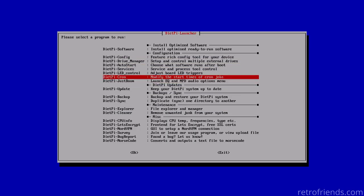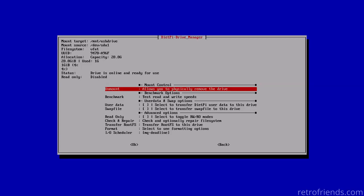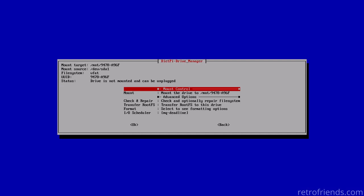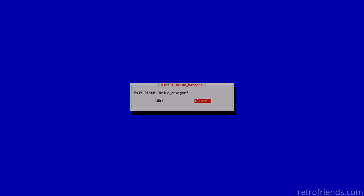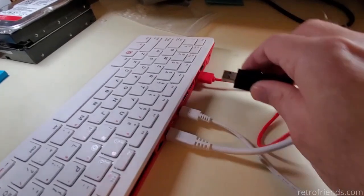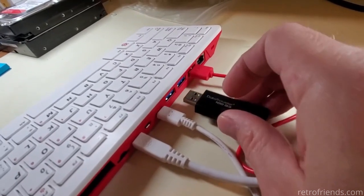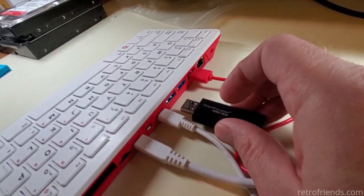And go back to the drive manager to unmount the USB stick. If you are thinking you could just leave the USB stick in the Raspberry Pi instead of copying files and simply access it via AmiBerry directly, why yes, you can. However, in my mind, I would rather use the USB stick elsewhere instead of trapping it in the Pi. And moreover, if you remove it or move it to another USB port on accident or otherwise, you will have problems, such as AmiBerry failing to load for missing kickstarts or the drive manager locking up because of a broken mount point. Trust me, I know. Now, simply reboot your Raspberry Pi and we will proceed to the next step.